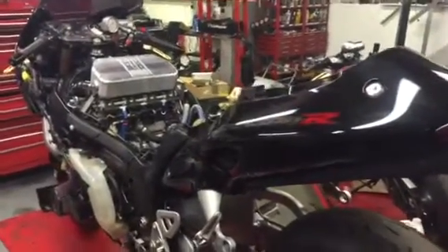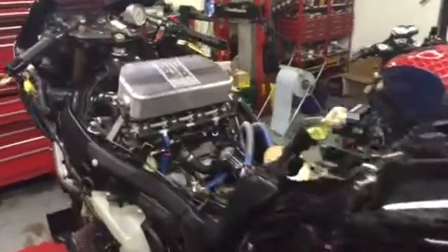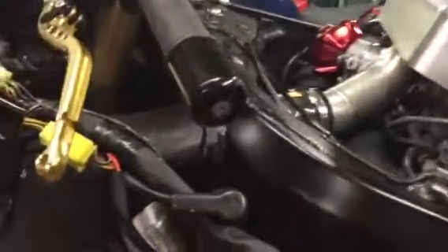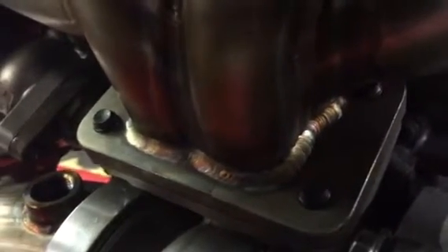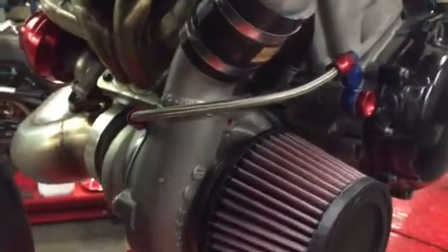This is the installation video of a Big CC racing turbo system, covering the plenum, pipe, turbocharger, wastegate, header pipes. You can see the fabrication and welding quality: stainless exhaust housing, GT30 ball bearing turbocharger, and oil feed pipe.